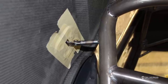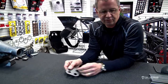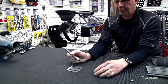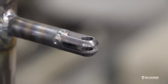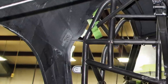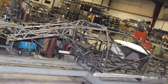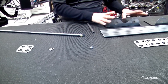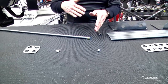It'll only take about 10 minutes for it to get solid enough to hold that in place. Now what you've got is a plate on the inside of the body with this tab on it. So instead of fitting this tube to the plate and welding on it, we're going to fit this tube with this clevis on it. What that gives us the ability to do during construction is obviously we can pull these bolts out and take the body on and off, because you're going to have the body on and off the car 20 or 30 times while you're building it — just fitting things and checking, take the body off, do some welding, put the body back on. During that whole time you'll have these plates fit up there with no holes. In the back, you'll just pull these bolts out, slip the body out from the tabs, and slide it off.